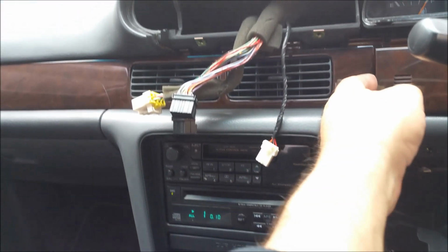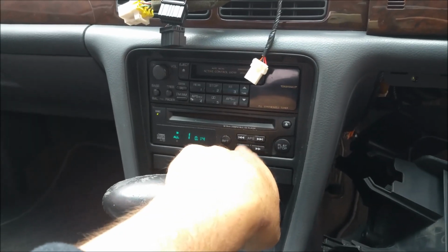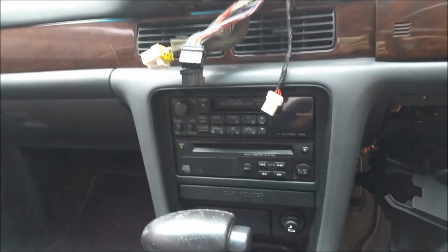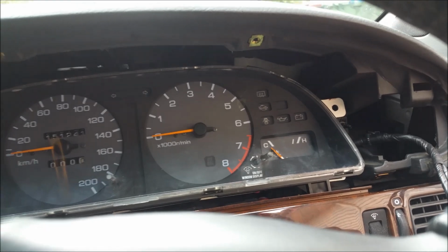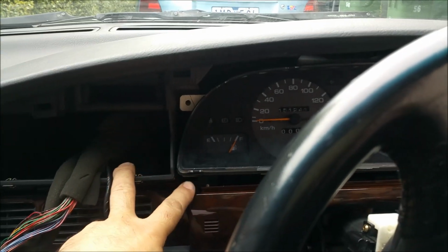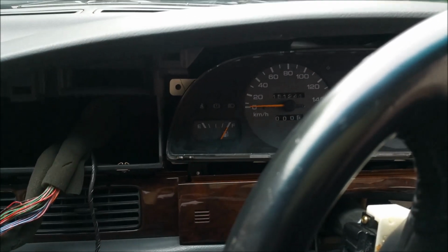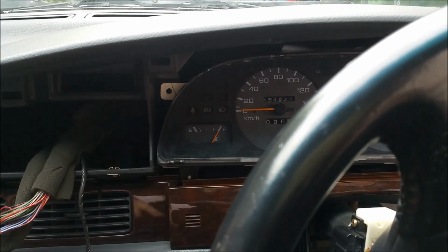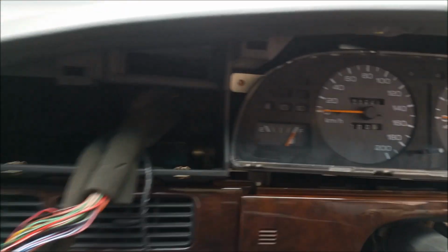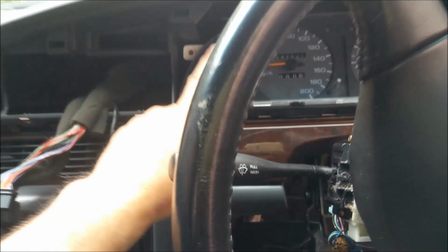So very, very pleased. I've just got to sort out this, has it got a pause? So yeah, I've just got to sort out this wiring. I've now found a wiring diagram for the Ultima, whatever the Americans call them. So I can check all the pinouts and do it all properly with the meter. But I'm tipping that that stuff's all going to be good. It's something in here or in the head-up display unit.